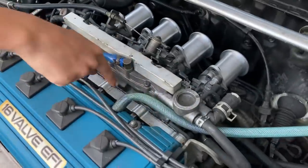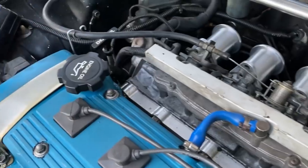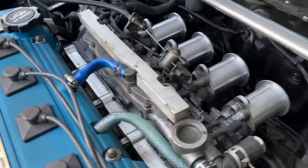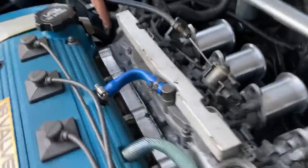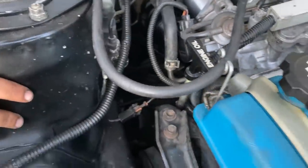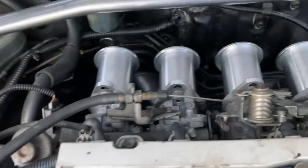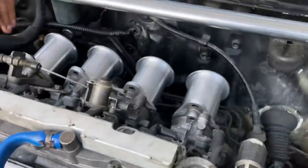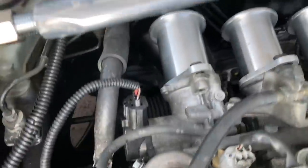This is the adapter plate, so it's made out of billet. It's basically an adapter for the AFE to the 20 valve intake. And on this side at the bottom here, you have to cut off the ear because of the water pipe. So I had to trim just the ear off. I use the stock cable still. Basically it's 20 valve injectors as it comes, TPS from the 20 valve. It sits on this side, and then the 80 mil trumpets.